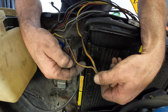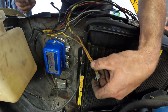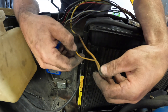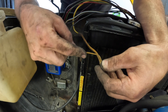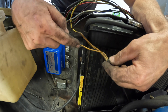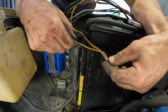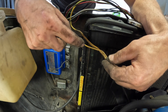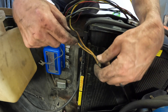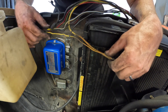However, it has a small yellow wire on it that goes back into the loom as part of the idiot light. We're not going to be using the idiot light with this one-wire alternator conversion, so I'll just be cutting it and taping it into the loom. I'll be putting a voltmeter in this car eventually — maybe a digital one as part of the accessories — so I'll just cut it and tape it up.